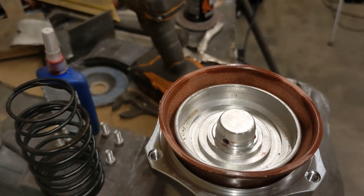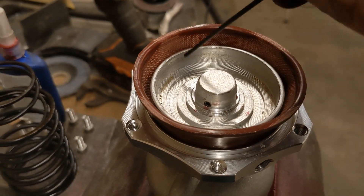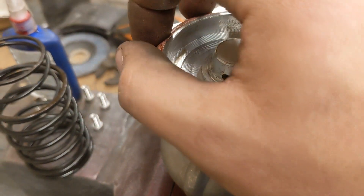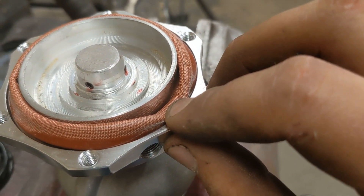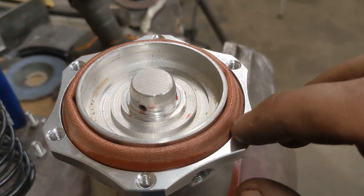Definitely have to be careful. Also, you want to check that the diaphragm is in good condition — make sure there's no tears. A lot of times you'll see it doubled over; when it sits down into the seat, this part will be like folded down and pinched by the top. So make sure that you double check that.